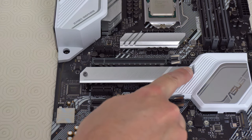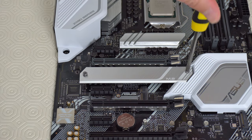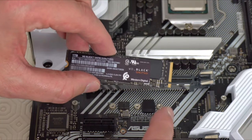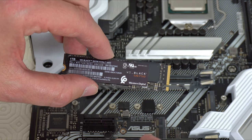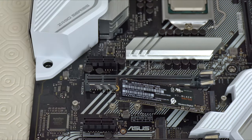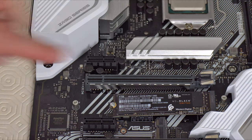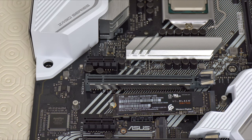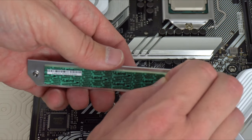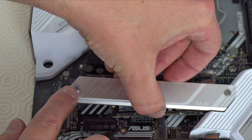And take off the plastic top. Next we need to take out these two screws and take off the solid state drive heat shield. Now we're going to put in the solid state drive and as you can see here it's keyed so it can only go in one way. So let's slide that in at a slight angle, then push this down and screw it into place just here. You don't have to screw this down too tightly. Once you've done that we can put the heat shield back on, so first let's take off the plastic, and then put it down and screw it into place.